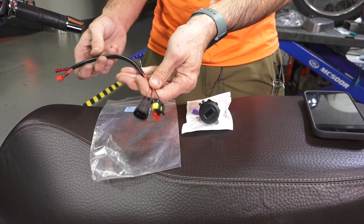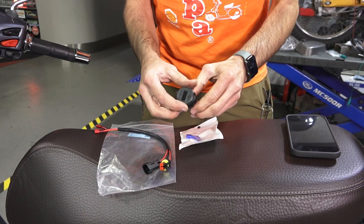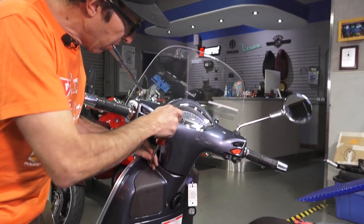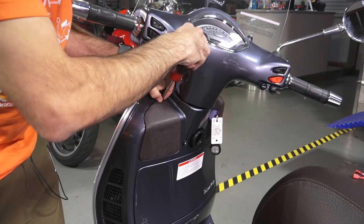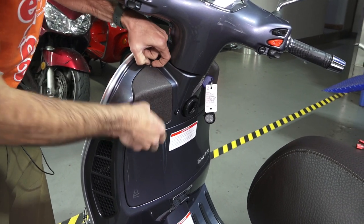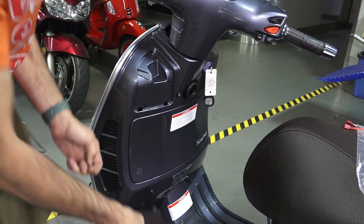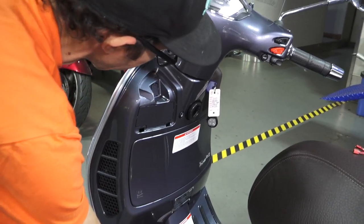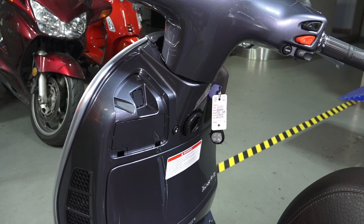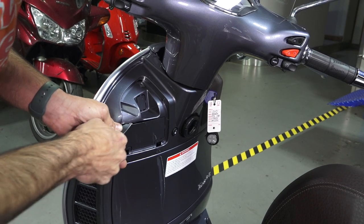Let's get to the installation — it's really simple, only a couple of things you've got to do. The hardest part is you need a large step drill bit, and I'll show you how that's done to make a clean hole to install the USB plug. Start by removing the left side — I call them the kneecap. The right side is your coolant level, that's where you check and the coolant tank is. You need a T25 Torx driver. The cap just removes pretty simply. Next you're going to find an access panel that needs to be cut out. This access panel has cutouts with small tabs, and I recommend having a sharp knife — you'll be able to cut right through each of those tabs.